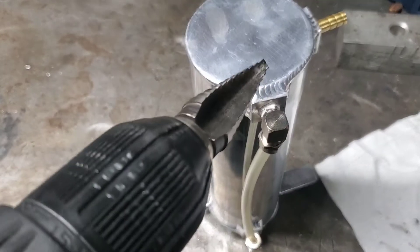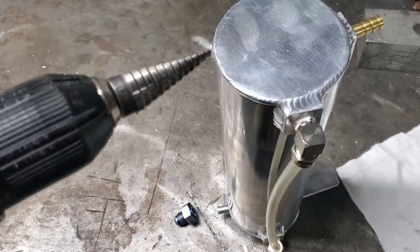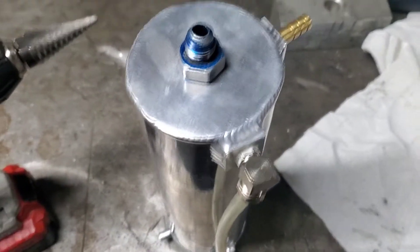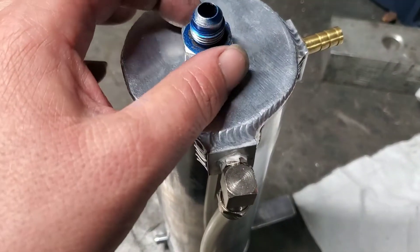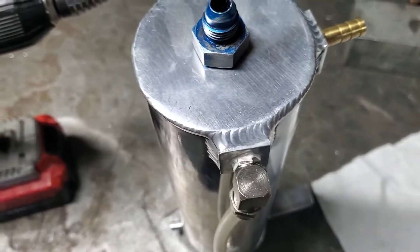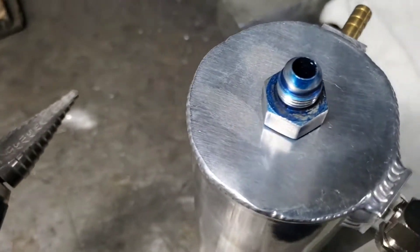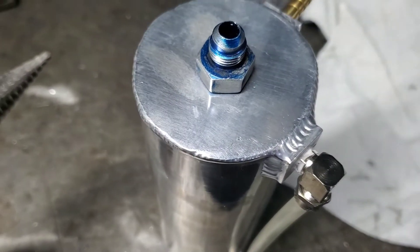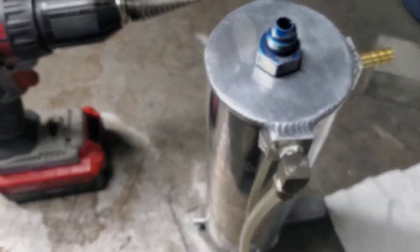It's just aluminum. I'm a pretty big fan of unibits, especially when we just got to make a little port hole right there. And then a dash six breather line — drill a hole, weld it on. Obviously I need to clean this up a little before I weld it, and then we'll have our port fitting on there.